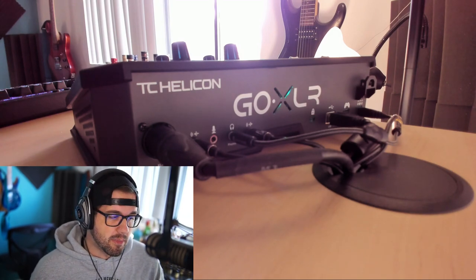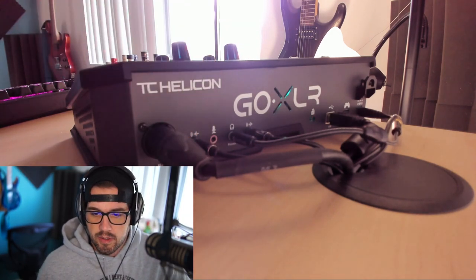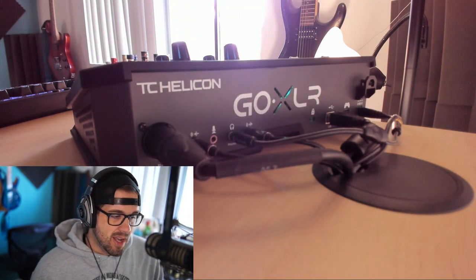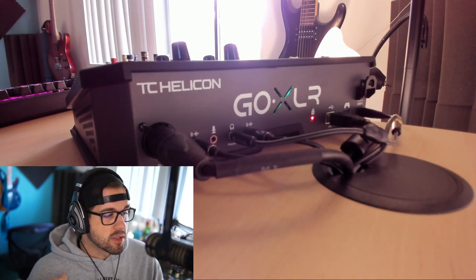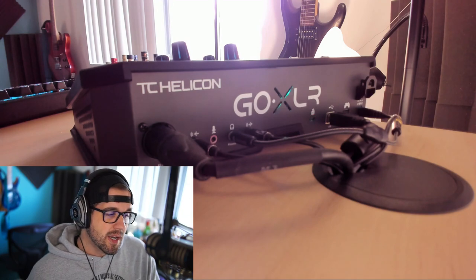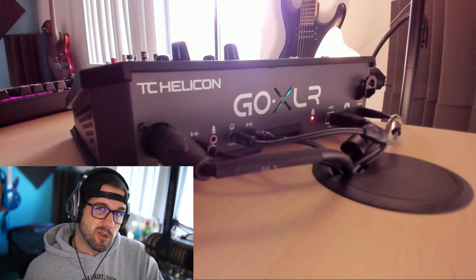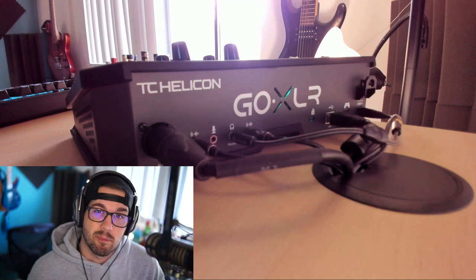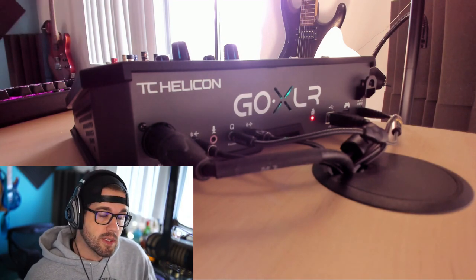So let me take you through the setup. Here you'll see the backside of the GoXLR. We have our XLR input coming in from my microphone. We have the line in on the GoXLR, which is a 3.5mm stereo cable — that comes from my game PC on the motherboard output, the normal port you'd plug headphones or speakers into. On the back of the game PC, it'll be red, black, or green. Then on the backside of the GoXLR, we have the line out, which in this case goes to the line in on the game PC — typically blue or pink — so I can send my microphone from the GoXLR through the routing table into my game PC.